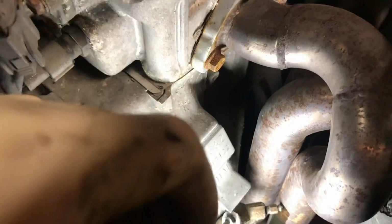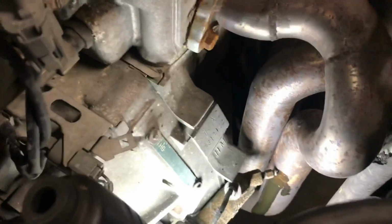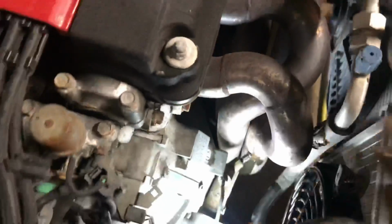Go ahead and pump. You want to have a tube on that so that when you bring the pedal back, it will draw in fluid instead of air. But considering our situation here, we are in a predicament. Maybe I can try to supplement it with my finger. Go ahead. There it was, it pulled air again. Go ahead and pump.